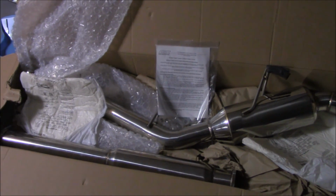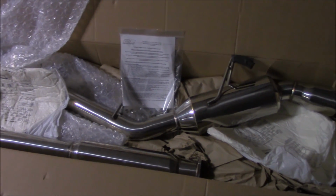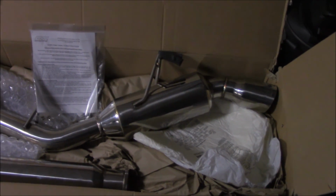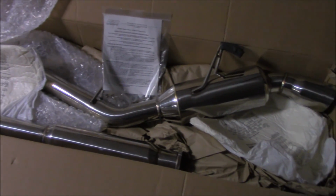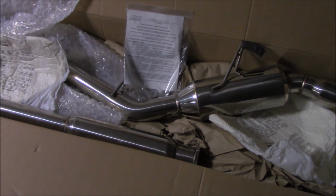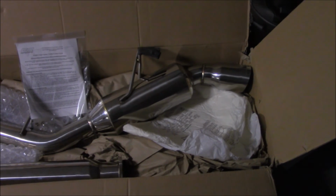Slightly, from what I've heard, slightly less exhaust pressure because it doesn't have to deal with any type of baffling or channel system versus the straight through exhaust like what you see here. It's a straight through canister style muffler where the tip actually angles straight back out. But overall, there really isn't much other than slightly less back pressure on it, and even then might not be founded. My thing, from an engineering standpoint, might be a little bit different. Instead of exhaust note coming out of 2 tips, you now only have it coming out of 1. However, it is a straight through design, and if it's anything like my old Subaru's exhaust system, one type of straight through muffler actually sounded really good.